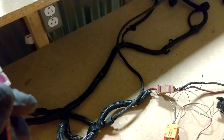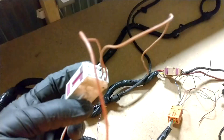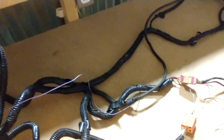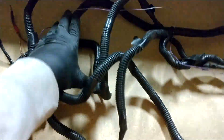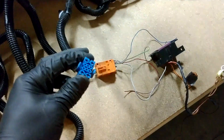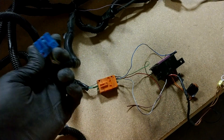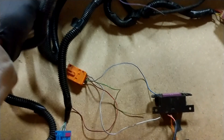The white connector — I really don't know what it's for, it hasn't affected running or anything. I deleted a few wires out of there. I anticipated it might have something to do with the tachometer and AC. Then there's the ground harness — it looks like a mess but it's really not that bad; it's just how the wires interconnect. The only reason to take it apart is if you have to route it somewhere specific. My fuel pedal wires off the blue connector weren't long enough, so I just cut and spliced in an extra three feet.